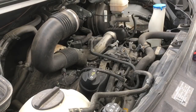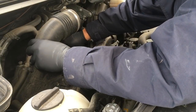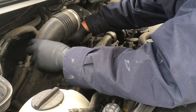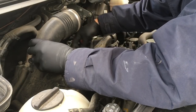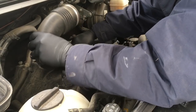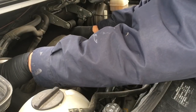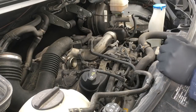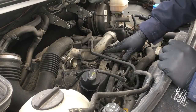There's our air box out. Our next operation is to remove the turbocharger inlet pipe. There is one band clamp that goes on to the turbocharger — just loosen that band clamp with your flathead screwdriver and remove it. You can just set it aside like that.